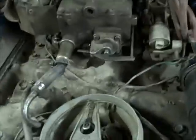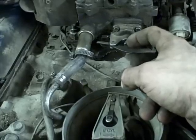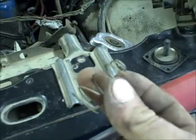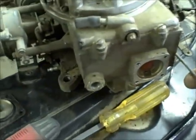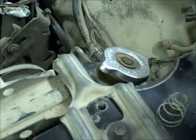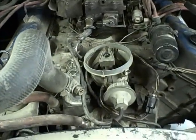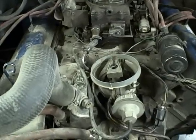I'm going to make sure this isn't a complete waste of a day. I was noticing this accelerator pump - it's like the spring isn't pushing out enough. So I've taken this carb that I got and I'm pulling the accelerator pump out of it to see if it does any good, because I'm not going to go buy an accelerator pump right this minute. All we've got to do is undo these four bolts - I've already loosened them - and I've got a good spring and a good diaphragm here. Hopefully we get a little bit better off-idle response.